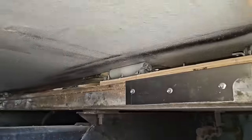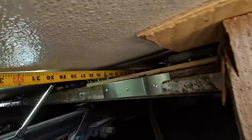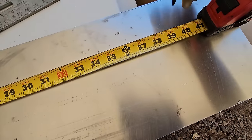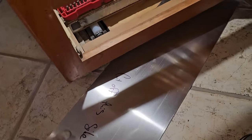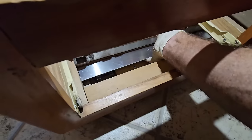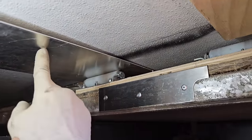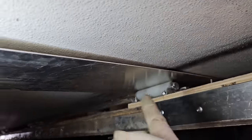I staggered that roller to keep everything in alignment as it goes in and out. So I have to jack this back up again. I already have these cut to width — I just have to measure and cut them to length. I'm all the way against the back of the cabinet there, and 39 inches is about where it needs to be. I can feed it in from the floor underneath the slide-out because it's too long to fit in the other way. I'll just slide it on top of that roller and slide it back. I can center it on the roller right there, because I'll be putting some screws here and I want to make sure those screws don't engage with the roller or the roller mount itself.